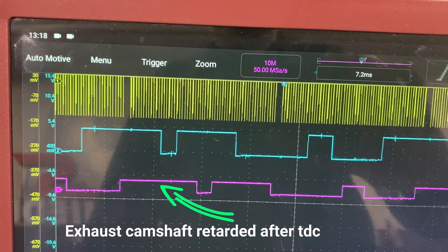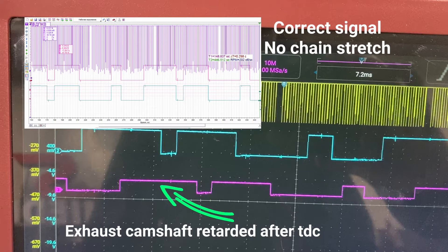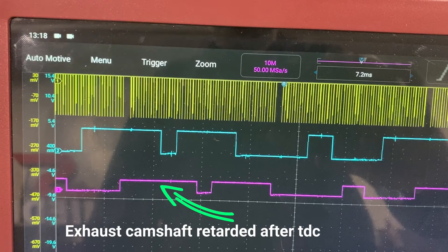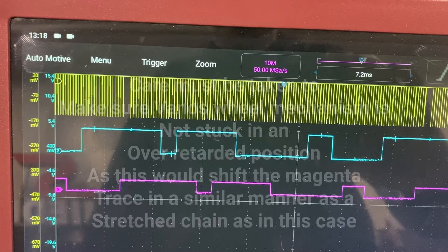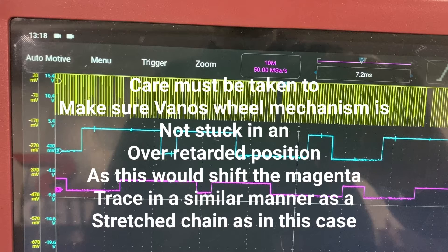When we look at the magenta signal underneath, there's a massive difference — it's completely shifted way over to the right, about half an inch. That's the exhaust camshaft position sensor, and we could say it's retarded because it's doing its work after top dead center. It should kind of open a bit earlier — it's not lining up with the intake cam at all, and that's the issue.